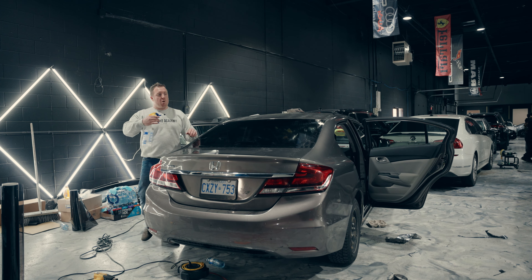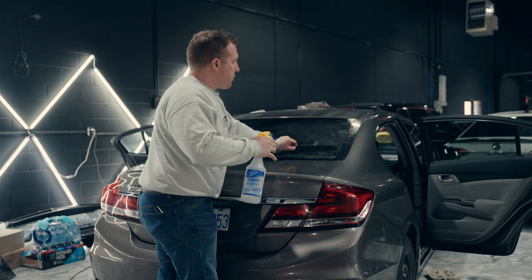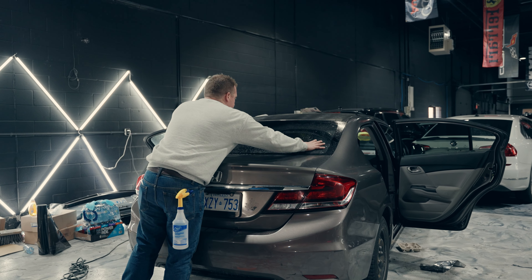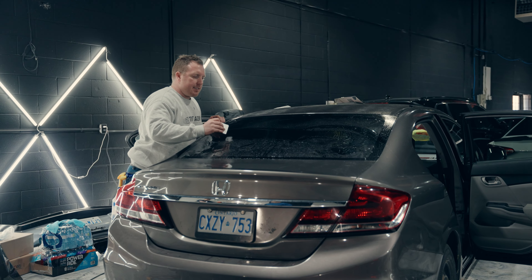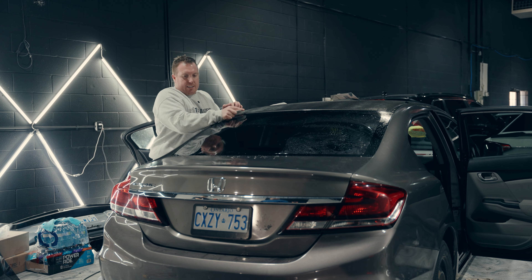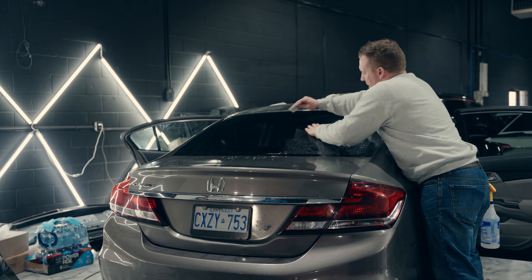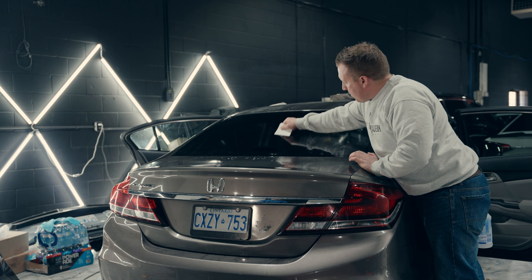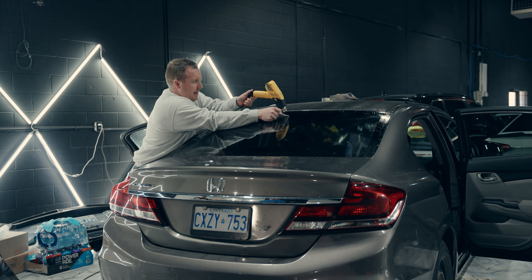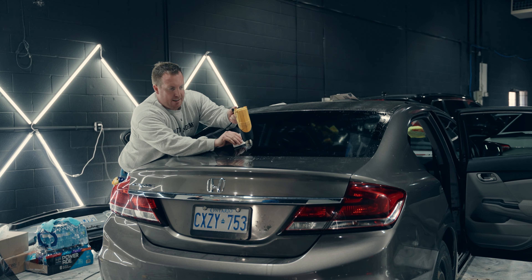Once I've made my final cut, we're going to do what's called a wet shrink. I'm going to lift my film and spray underneath. The purpose of doing this wet shrink is to get rid of any fingers. A lot of guys will skip this step, but we find it very important during our courses to minimize any fingers coming through the actual film. Once I wet underneath it, I'm going to spread my film back out, use my hand to get rid of all the big water pockets, and with my hard card reinforce and redraw my H, pushing all that excess water out from the film. If I were to install right now, we'd probably get a couple fingers coming through. I'm going to run my heat gun over top to get rid of any excess fingers. If you do have an issue with fingers when installing your rear window, you can do this one or two more times to make sure you don't get any of those fingers popping up.